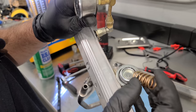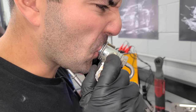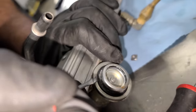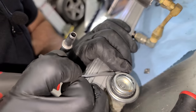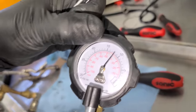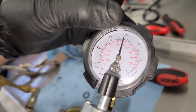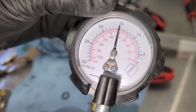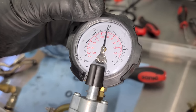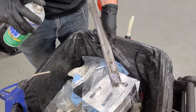The diaphragm is on the inside, built into the bottom portion where the spring rides. The MightyVac confirms the diaphragm is fine. But this O-ring does not look good at all — flat as a pancake. Testing it with vacuum shows it's leaking. We fixed it with RTV for now; I'll order up a new seal. With that fixed, let's clean the other rail.